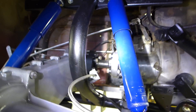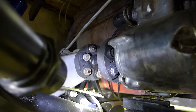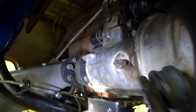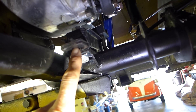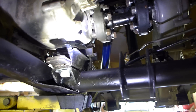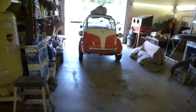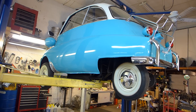As you can see, that makes for a nice little upgrade. It comes with a new end link — I'm shining my light on it — that is shorter by an inch. The springs have been drilled; you can see the springs hanging out there. There's an inch there where the bolt used to go through. That brings the rear axle a little closer to give us that one inch needed to line up the driveline. It makes good sense for our little Isetta friends.